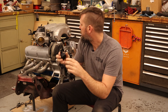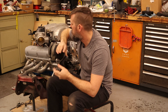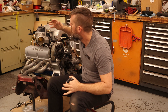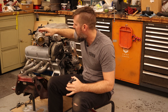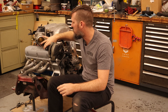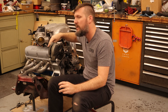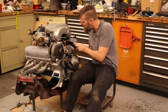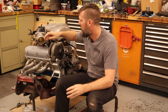My plan is to mount the coils on top of the valve covers, like a lot of other coil-on-plug or coil-near-plug setups you've seen. As I had mentioned previously, I had the tall valve covers and I was switching out to different ones — this is the reason why, to be able to mount these coils on top. So I got rid of the tall valve covers and went with some Trick Flow ones that still have plenty of clearance for the 1.6 roller rockers. Everything I've rotated the engine over clears fine.